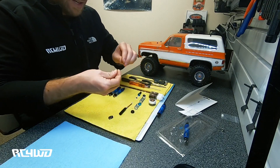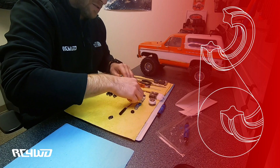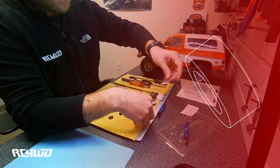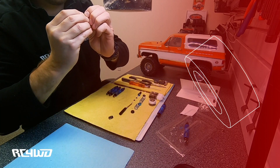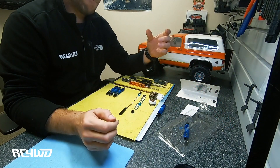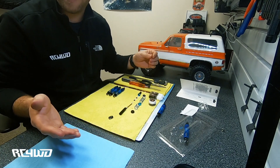These are going to be really hard to see so we'll probably include a picture, but there are two x-rings instead of o-rings — so there's a double seal on each one, almost like there are four o-rings in there. The spacers we have come in two different widths — a thicker width and a slightly smaller one. The difference is only about 0.2 millimeters, but that compresses the x-rings a little more to give you more sealing power. So you're going to lose less oil over time — there's no such thing as a perfectly leak-proof shock, but we've done the best we can.